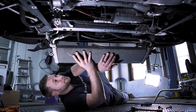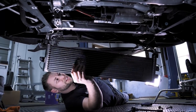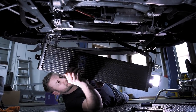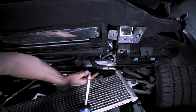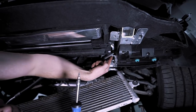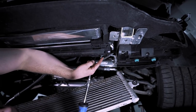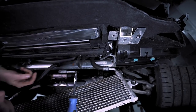And there's three. You can just very gently ease this out of the way. Now this piece that we just lowered — this is what's cooling down your oil. What we need to get to is actually right about here, and you can see the two ends of it right there. To do so, we're going to need a T25. There's one screw on this side and one on the other.